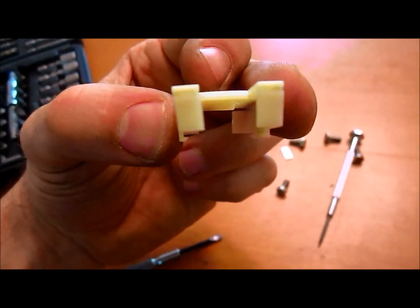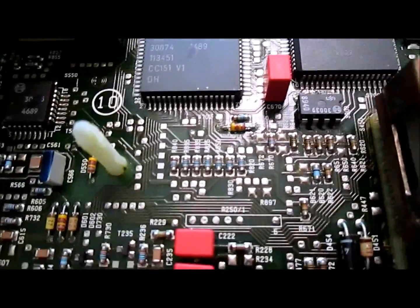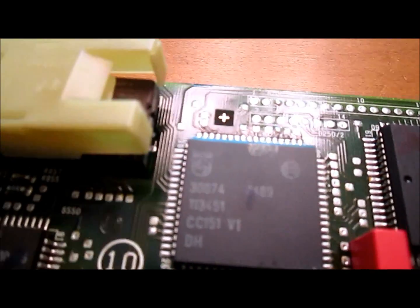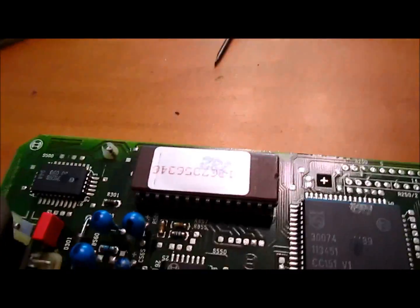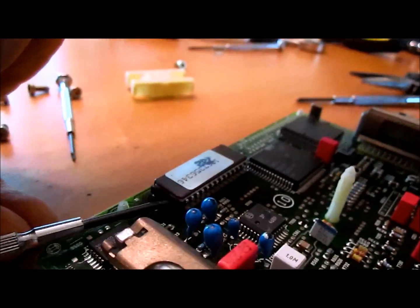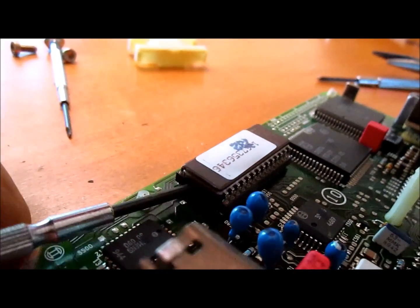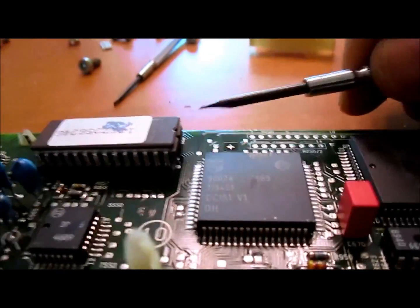There are little plastic teeth where my thumb and middle finger are — they hook underneath the chip. What you want to do is use a little screwdriver, push it into this little slot, press it in, push out, unclip one side, and then do the other side. To remove the chip — it's not that difficult on the M42 engine — simply take a small flat-head screwdriver and insert it in between the chip and the eProm board.